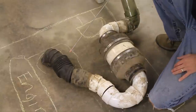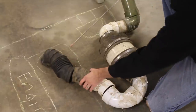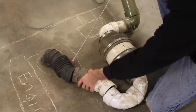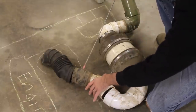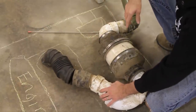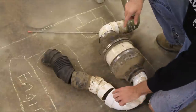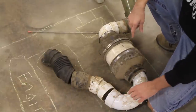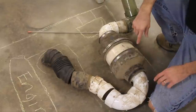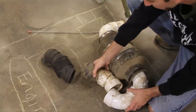Let me show you these parts. This is the little stock rubber piece that comes off the intake manifold — I just reused that. Then I had a little piece of three inch PVC that connected onto that rubber piece. That rubber piece let me get a slight curve out of it. Then I've got another three inch piece going into a 45 or something, and then I've got two 90s. There are two different types of 90s in PVC: wide arc and tight arc. I used two of these wide arc pieces for better air flow, and it also allowed everything to line up.